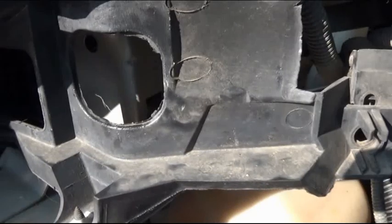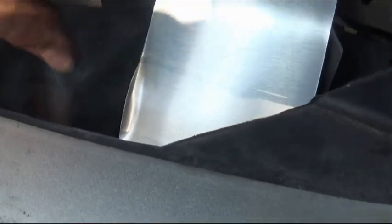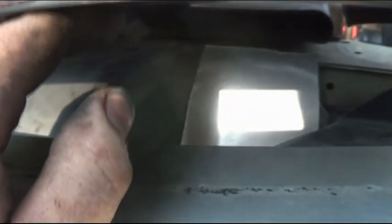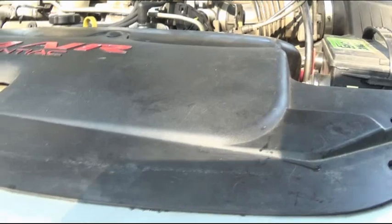The next modification — behind the ram air setup there's a hole and a piece of plastic meant to divert air into the ram air, but there's a big hole behind a piece of aluminum on a very steep slope. What I did was roll this aluminum so it sits under there — in theory the air doesn't go into the hole and instead rolls right up into the intake when the plastic guard is down. I may add some sealer so air goes the right direction. I tested with an air blower fan positioned behind the car and with the ram air setup off the air box, I could feel air coming through, so it's still getting airflow even at low speeds.